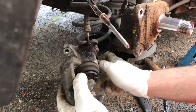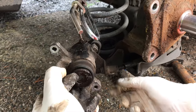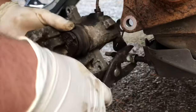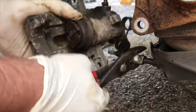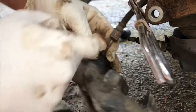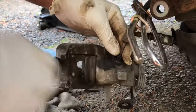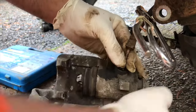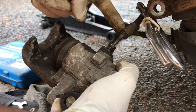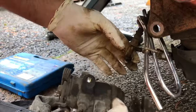You need to pop it out of this little clip in here. There's a couple of little tabs that you have to depress to knock the cable back through the caliper. See where the line is stuck inside the nut? It's twisting the line around. So rather than break it, we can just twist the caliper off of the line rather than undo the nut — otherwise it would have sheared off. And because it's part of this line, you can make up new brake lines, but you would have to buy this new flexi hose. So we've dodged the bullet there.